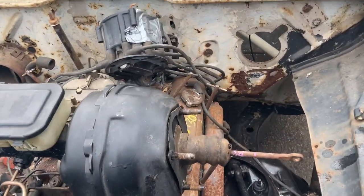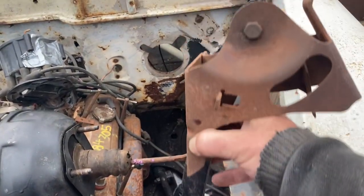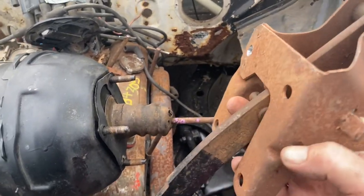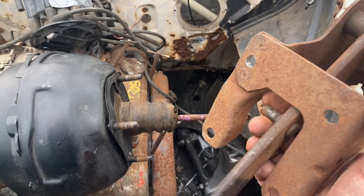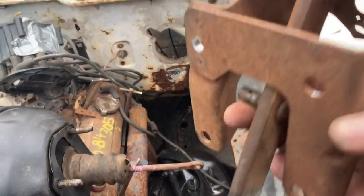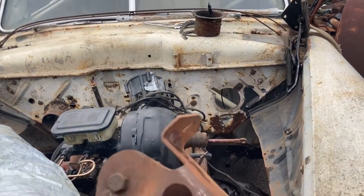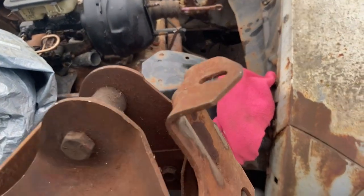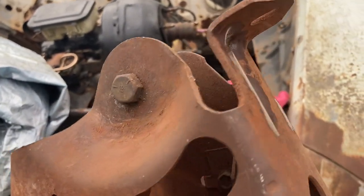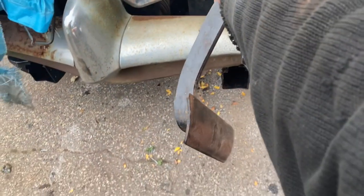Once that goes through the firewall we'll need a brake pedal, which I have here — I've been saving it for years, and this is the reason. I enlarged one of the holes, and now it'll just pull up to there. I checked on the inside underneath the dash and everything fits, except for that top tab there — this one has got to go. I think we can nip it off so it looks neat. And there we go, we've got a brake pedal.